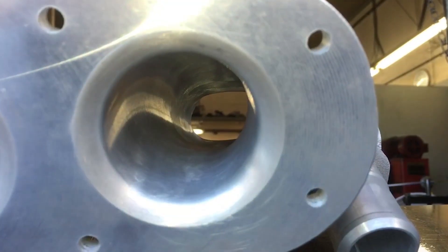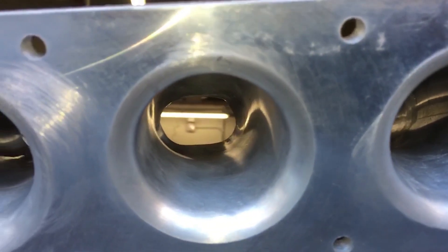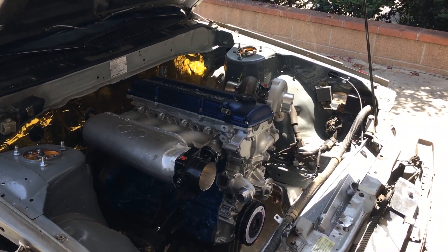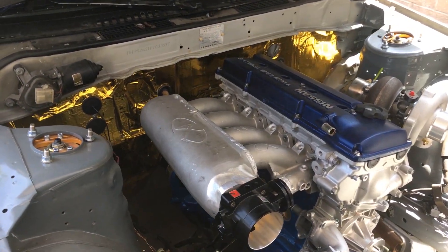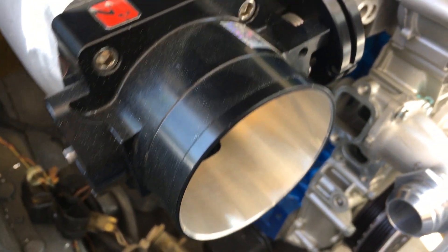The cold side is an Excessive Manufacturing KA intake manifold. I welded it and modified it to accept a Skunk2 Honda throttle body — don't hate me for that. There are a lot of reasons why I went that route instead of going with like a Q45 big 90mm throttle body. I'm actually having doubts about the 74mm Skunk2; I might change it up. I'm also doing a V-mount intercooler setup, so it's going to be super efficient, cool everything down really nice. I'm going to cut a vent in the hood and duct everything.